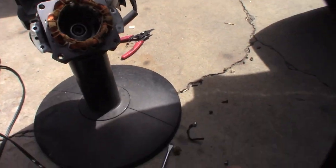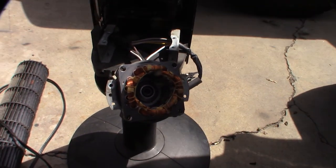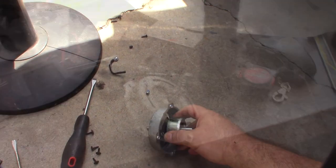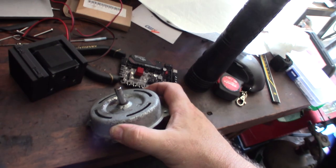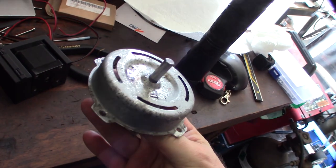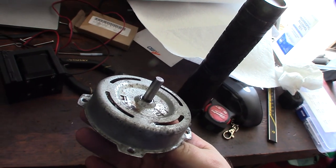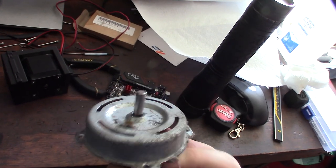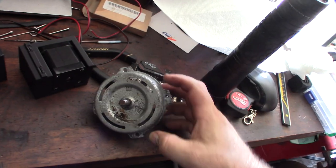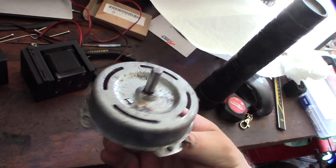It clearly feels like it's locked up in the front. I'm looking for debris in the motor internals, but it looks fine — I don't see any debris. But this thing won't spin on the top; something got in there. It's a bushing, and usually what happens is bushings wear bigger over time. I've only used this fan a couple months out of summertime, so it's probably three or four years old. This thing is not spinning at all. I'm going to get some lube in there and see if I can push it out — there's a damper in there that allows it to pivot.